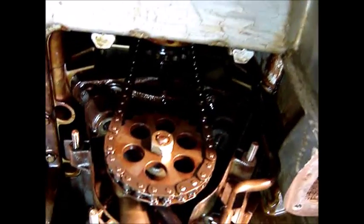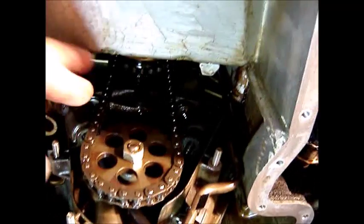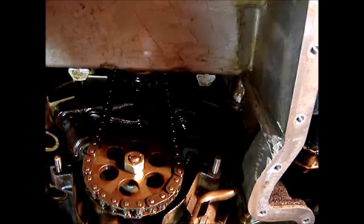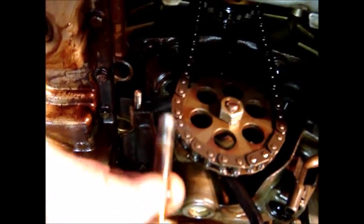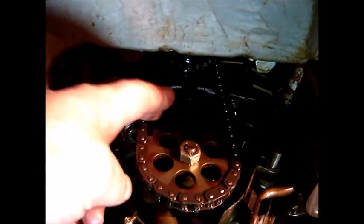Now I need to get the Loctite and snug this nut up. Once that's snugged up I can take the nut off the back side, put Loctite on it, and run it back up so the pump is fairly secure. Then I can pull the Allen wrench out and start running the bolt back in. I want to double-check the chain tension before pulling the wrench out. Assuming it's all okay, once these nuts are in place I'll pull the wrench out, put the bolt back, and in every case I'll be using Loctite. Once it all gets back together and tightened down, I'll do one final check to make sure the chain tension has remained within spec.